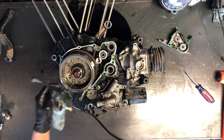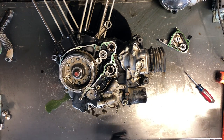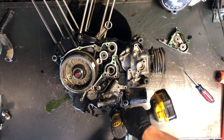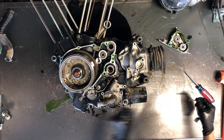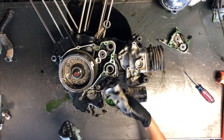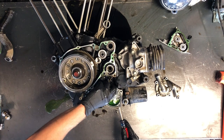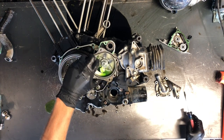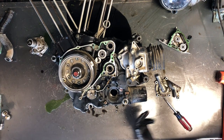Cover is off — there's your stator assembly. That's where your energy comes from on your motorcycle. We've got our flywheel here and our idler gears. We'll go ahead and pull the stator and the shift shaft. We've got a water pump with a boot covering our oil sensor and a sub-harness that goes to two sensors. Four 10 millimeter bolts on the water pump. Water pump cover is off. What seals it is that O-ring — there's your water pump, off at this point.